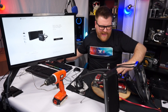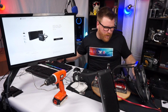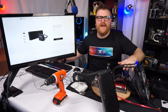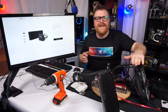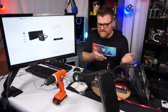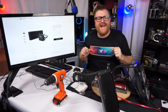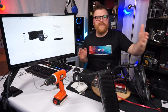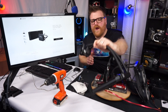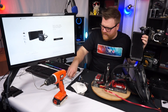You plug the fans into the header, much like on the newer one. You actually plug the pump power over a Molex connection, and then a one-wire connection onto the CPU fan header on your motherboard. Older budget motherboards didn't have a lot of fan header control, so they took it into their own hands. There's also a proprietary connector on the old one for Corsair Link version 1. The new one has a straight-up USB connection to plug into your motherboard if you want to use the software.